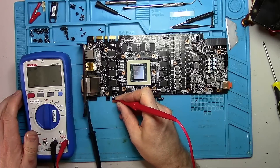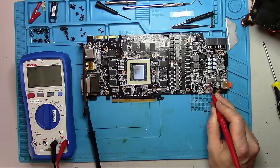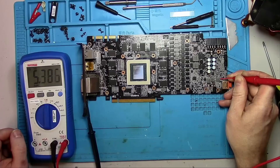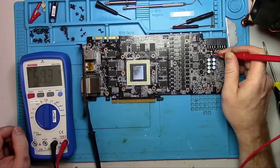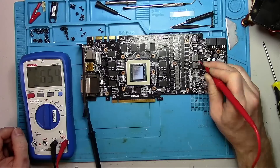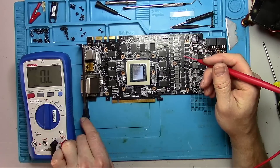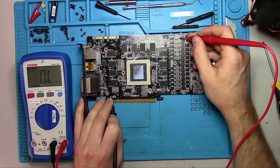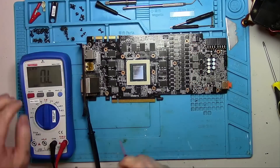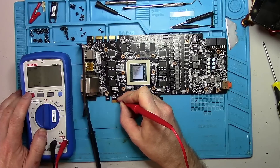Let's take some measurements. 12V — Kiloohms. I'll check this fuse here just in case. 1.8V under 900 ohms — very good. 12V — Kiloohms. 5V just under 6K. Another 12V here at the top, also Kiloohms. PEX around 70 ohms. Memory at 65. The V-core is too low to measure with my cheap multimeter, so the only thing I can do is measure it in relationship to the 12V, because if they are shorted, the GPU is 100% dead. Last voltage rail is 3.3 and this one is also looking good at 4.6K.